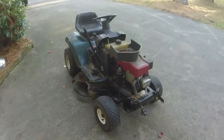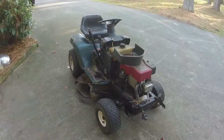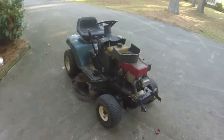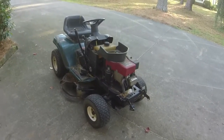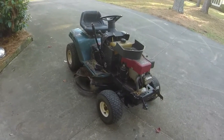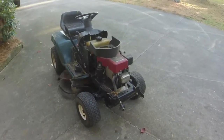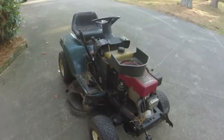Welcome to Ellis Mowers. I just pulled this over into the driveway — this is my neighbor's mower. Someone gave it to him. All I've had to do is help him clean the carburetor, which just had a blocked main jet, and I got a pine cone stuck between the blade and the deck one day which bound it up so the blades wouldn't turn. Now we've got a starter issue, and that's what this video is about.